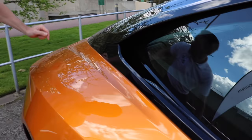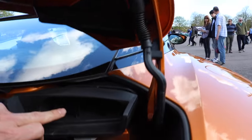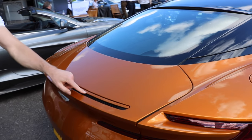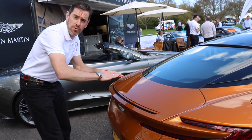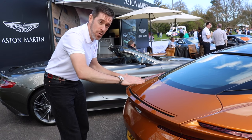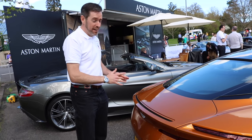That vortex takes the air down the side of the car and it comes into this intake just here. The clever bit is it comes out of here and into here, and ultimately comes out of the top part of the boot, creating effectively an air spoiler or downforce. The downforce created is about the same as the wing on the back of a GT8, which just shows you how effective it is — but you don't get the aesthetics of a big wing on top.